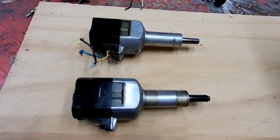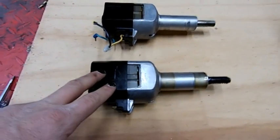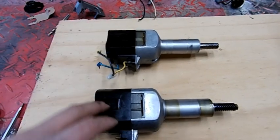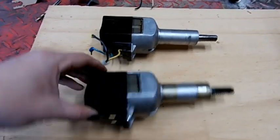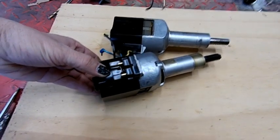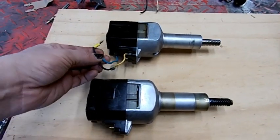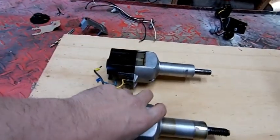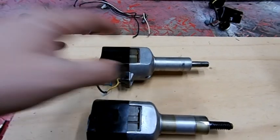Before I start marking and cutting on my aluminum housing, I want to point out this is why I did this and how I came across it. I serviced a motor for a 501 and then I tore apart a 620 that I was given because it was trash. When I was tearing apart the 620, it hit me that the motors are physically the same size. I thought to myself, why does the 620 have three wires and the 501 and 400s only have two wires? So I decided to tear the motor apart and find out why, and I found there's extra windings inside of it, which I thought was very peculiar. I serviced the motor and plugged it in and realized that this is a 1-amp motor versus — I don't know exactly what these were, but I think they're like 0.7 amp or not over that. So it's a larger motor but physically still the same size, and it will drop right into a 401.